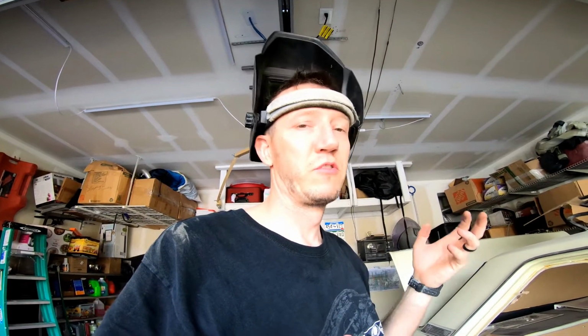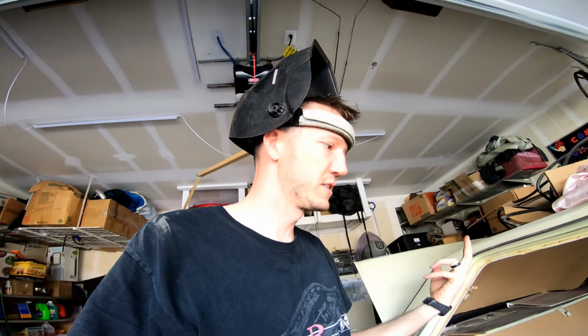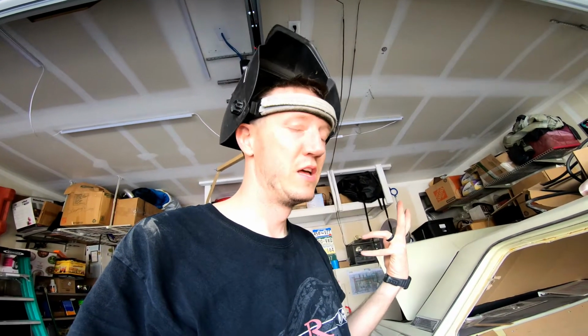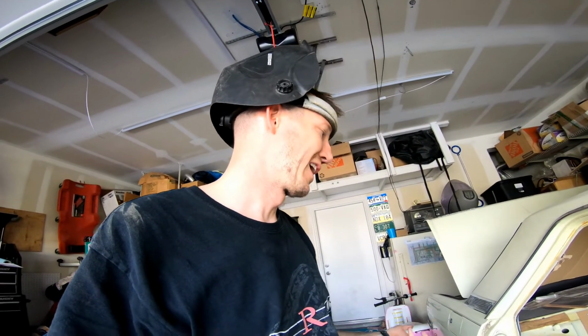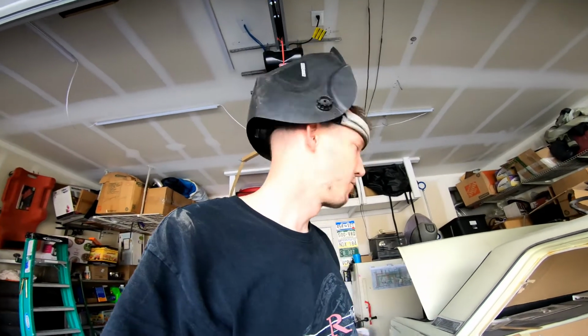It's one of those things, if the fuel tank is closed, there's no vapor, so it's less likely to cause a spark, or not a spark, but an explosion. But as I now move into the trunk, right where it's being stored, I am going to have to work on that and make sure that I don't end up hurting myself or burning down my house. So I'll have to take that out today, likely before I move to the trunk area.